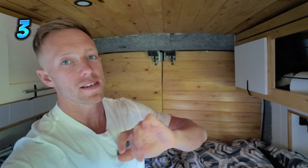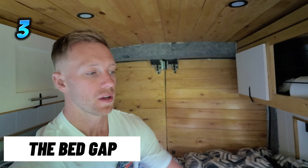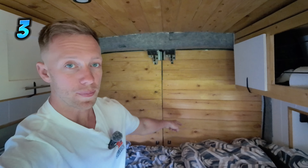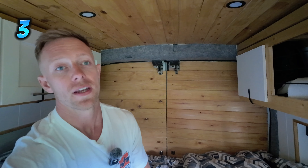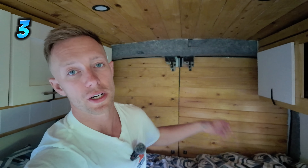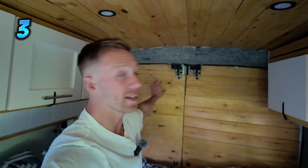At number three is the back of the bed — let me explain that in a little more detail. I've built a bed that goes across the van. I'm six foot one and I can fit comfortably across with the sort of built-in niche or flare areas. The problem I didn't think of is the gap at the back of the bed — when we shut the doors there's like a 250mm gap, and it's quite frustrating if you want to sit with your back up against the door and watch the telly. Going forward I'm going to put a wooden shelf across the back so at night we can use it to put drinks on, and during the day we can sit on it. I may need to lower it slightly and put a thin foam mattress on it, but definitely need to seal that gap — a draft comes up through there as well.